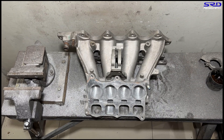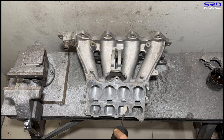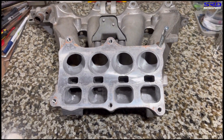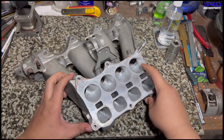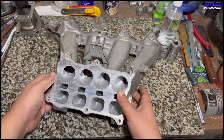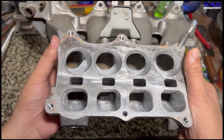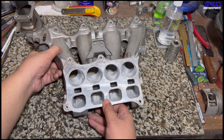Imagine running this on a B20 with one-up pistons or YCP Gen 3, get the proper deck clearance or quench clearance — this is going to be super efficient with excellent fuel economy while still exceeding 200 horsepower. Now let's get this washed up and back to the workbench. Look at that — way better than stock form. No longer rough from casting, it's going to flow even better. You can see we widened the short turn a bit to equalize airspeed.